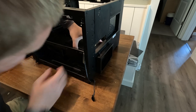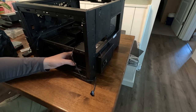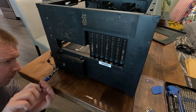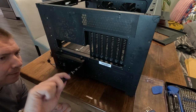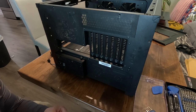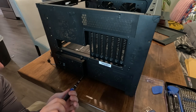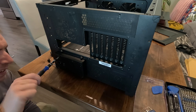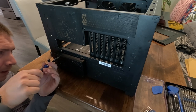This case has a cushioned base that the power supply can sit on, so it's sitting roughly where it'll be in the final build. All that will be left is to bolt it down. Whenever you're dealing with small computer fasteners, it's a good idea to never try to cinch everything down. I like using precision screwdriver kits — they're designed to make it difficult, though not impossible, to over-torque a fastener. Just get them snug; once the base of the bolt makes contact, no more than a quarter turn. That's plenty.